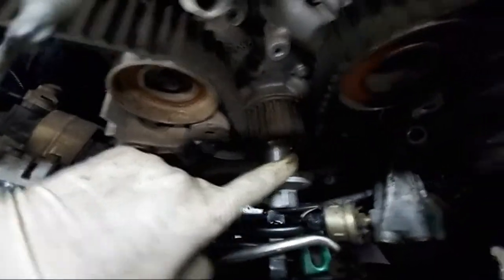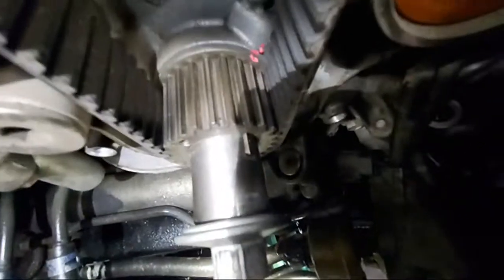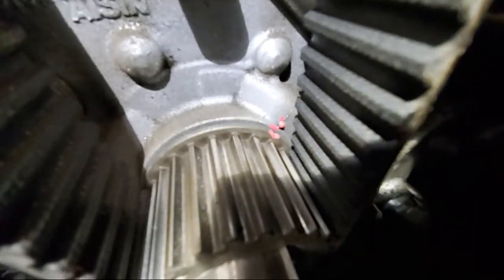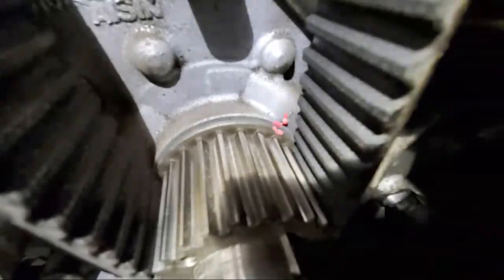On the bottom one it's gonna be on the crankshaft — check the key way on the crank. Let me get a flashlight. The key way on the crank is pointing — it's not right in the middle, it's pointing like at one o'clock. The key way is in there and in the back right there where the red paint is, there's another groove — a clear incision like a groove. And the actual part on the bottom on the back is a little tiny dot right next to the timing belt, like a ball or a point. That's what the timing is for the crank.